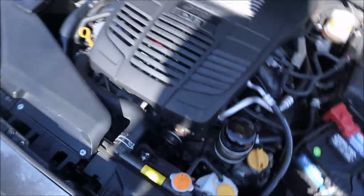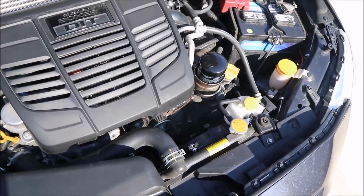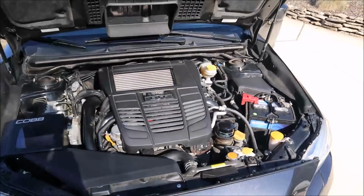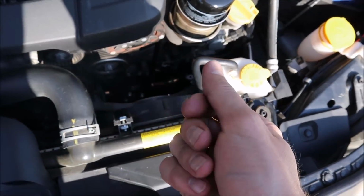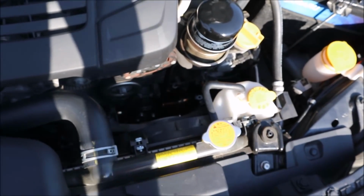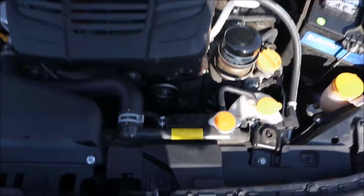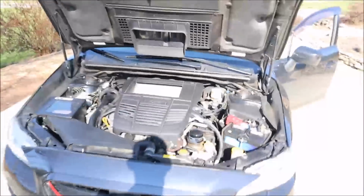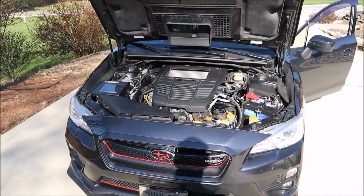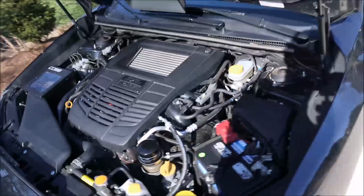So there is a little bit of smoke. There was some oil on the J-pipe when we installed it. You can't really see the smoke coming up, but there was some oil on the J-pipe, and I don't know if it was just a protectant from the shipping, but it definitely felt kind of slippery. So I think that's burning off, and then also all the penetrating fluid we sprayed down there. So it's just kind of smoking a little bit. You know, that ain't good, but it isn't terrible. Let it smoke out there for a minute.